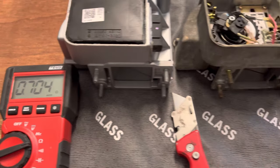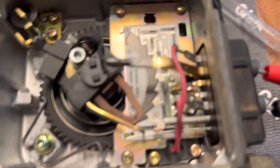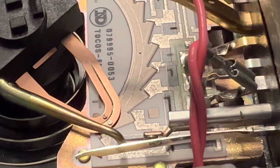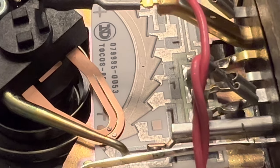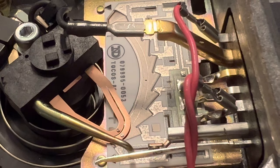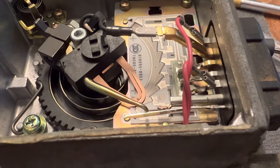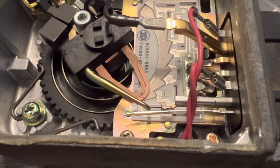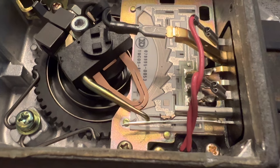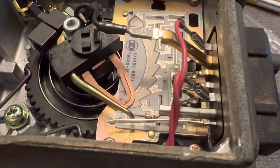When I first tested it, it was really bad. So I thought maybe we can take this apart, clean something, and see if that helps. You can see those two little track marks or grooves where the contacts of that copper armature are riding. What happens is it makes a groove, and the deeper that groove gets, the less reliable this connection gets. What can also happen is underneath the contact or copper-colored piece, there are little pins, and those can get dirty, giving erroneous results depending on where that arm is on the strip.